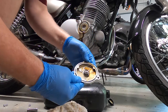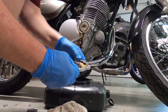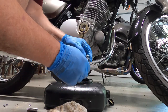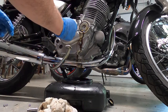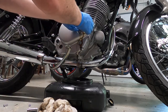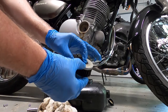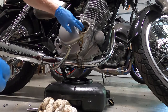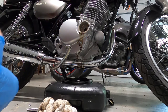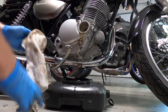There's an o-ring inside the gasket or the cover — make sure you don't lose that and make sure it actually stays in place. We also see a spring here, and the spring is what holds the filter up against it, so make sure that stays there as well. Now the old oil filter is out, and there is an o-ring installed in here that does need to go back.